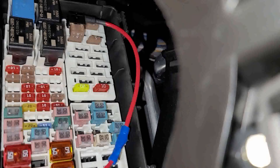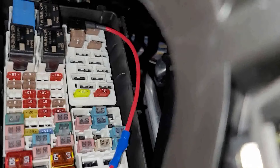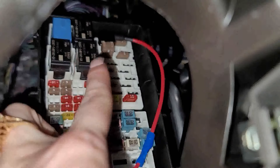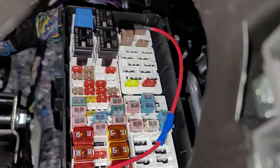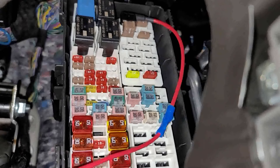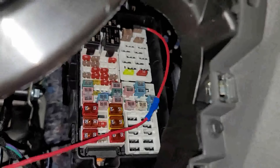All that work I did in our electrical panel is unnecessary if all you do is remove this fuse panel and instead of plugging into port 16, you plug into port 1, which is the top leftmost port. They're both 5 amp fuses, so all it is is relocating this wire and you can charge while your vehicle is remote started.